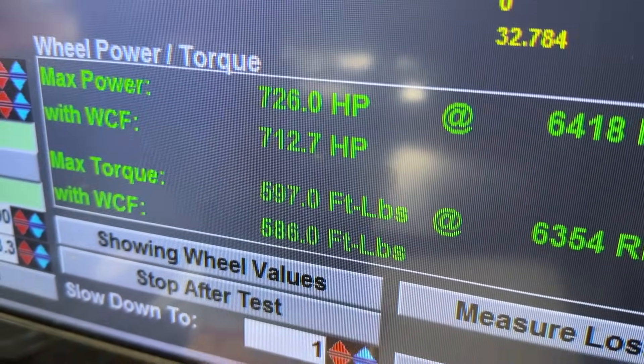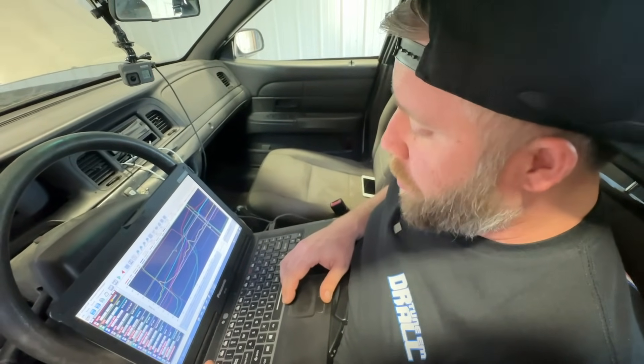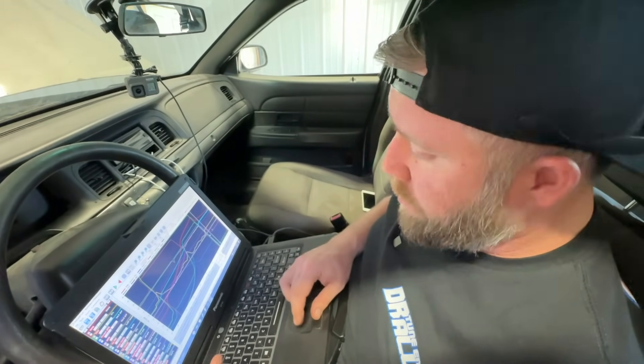Fifth pull result: 712 wheel horsepower! We're approaching 200 more horsepower than this thing came in here with — that's going to be a fun unit. Boost peaked at 23.4 pounds at 70 percent duty cycle on the solenoid with 13.6 degrees of timing — still light on timing. Manifold air temp peaked at 93 degrees after the run and started to fall off. Oil pressure looks good, battery voltage looks good, fuel compensation looks good. Everything still looks great, so we're going to keep going — we've got another couple pounds, might as well use them.